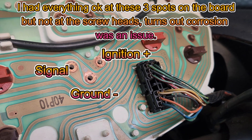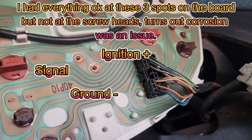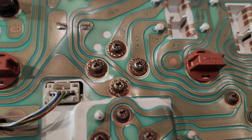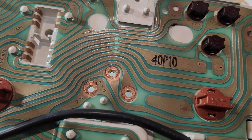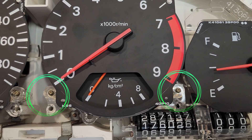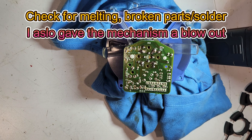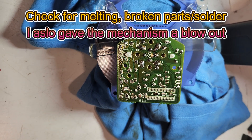I've taken the screws out that hold the tachometer in place and we are testing to make sure that there is voltage at each one of the positions on the printed circuit board — and there is, that is okay. As you can see on the speedo side a lot of these bolts and washers are quite rusty. This car is a T-top and it is quite likely there's been a bit of moisture inside this cabin over the last 35 years and a lot of this hardware is starting to corrode. So with everything else okay, let's remove this gauge. There are two small screws in the clear plastic we need to remove, and of course we've taken the three screws out the back as well. I checked out the back of the circuit board for the tachometer — everything looks good, there are no burnt out sections, all the solder is intact, there's no physical reason why this tachometer shouldn't work.